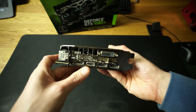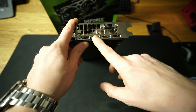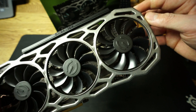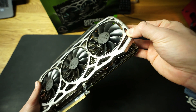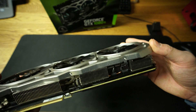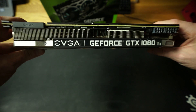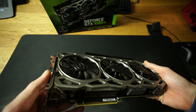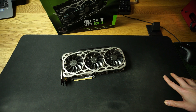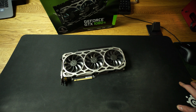For back connections you have three DisplayPort 1.4 and one HDMI 2.0 and a DVI slot which I'm not gonna use — though somebody still can. What I don't like about this card is the cover, because it's a solid plastic kind of thing. But I think it's reasonable because the weight of the card is already heavy, so they want to reduce weight. Otherwise your GPU is going to sag in the case. Let's benchmark this GPU at 4K and 1440p — you can check other clips to compare.